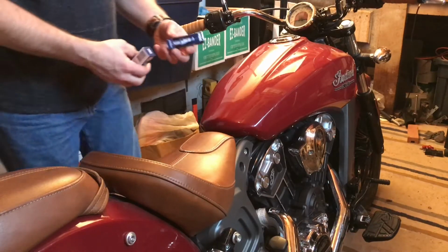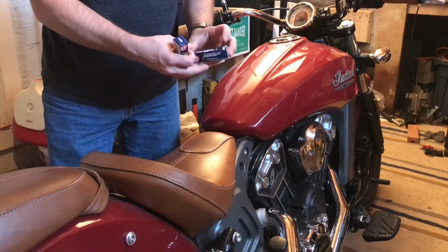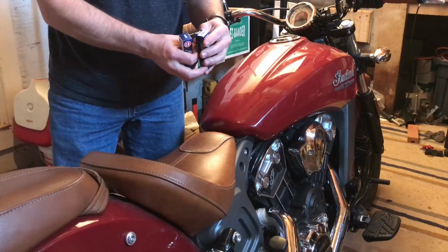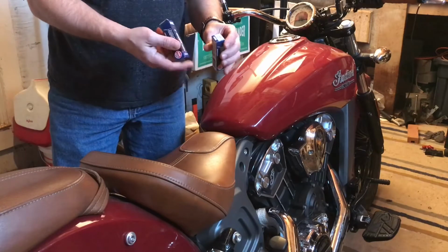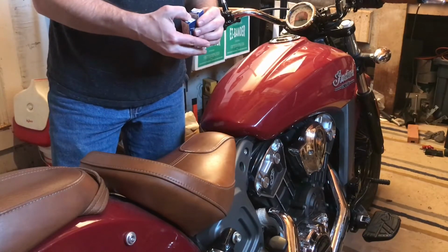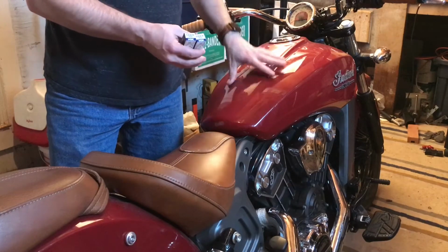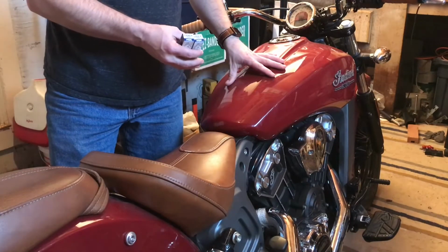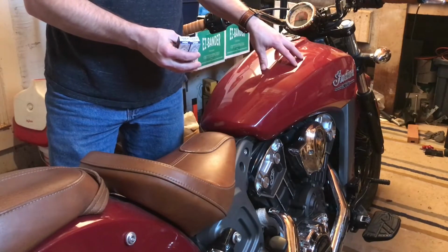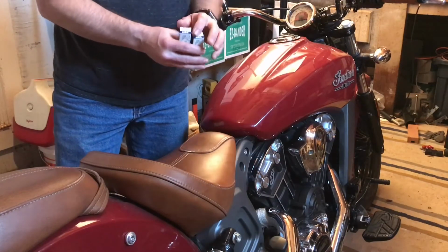Today we will be replacing the copper spark plugs with NGK Iridiums. I believe these are the right part number, CR9EIX. There is no direct interchange if you look them up by application, but I did a lot of research, Googling forums and everything, and a lot of the Polaris vehicles use the same plugs this thing does, and a lot of those Polaris vehicles can swap to these.